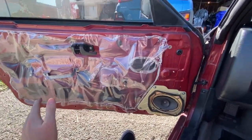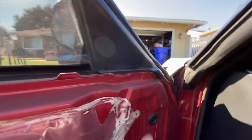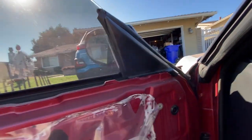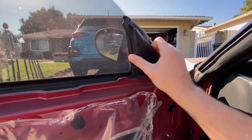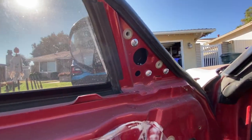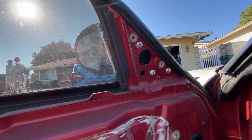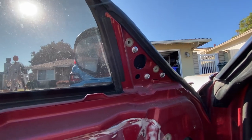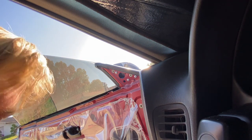Now that we got the door panel off, the whole door is exposed. The reason why we need to take the door panel off is because this little corner piece here is actually held under the door panel — there's a little lip that holds it under the door panel. All this is held in with just little clips. Mine aren't really held in very well because I broke them all last time. All you got to do is literally just pop it off like that. Now that that's off, you exposed all your little screws that are holding in the mirror. If you had the stock mirror still, they would be 10mm bolts. I don't, so these are Phillips head screws. All I got to do is take these three off and the mirror will pop right off. I apologize for the camera angle — I set it on the steering wheel.